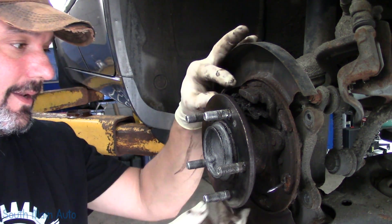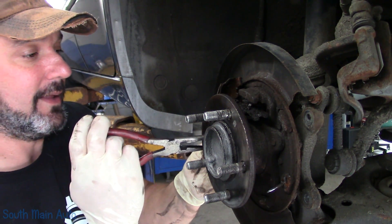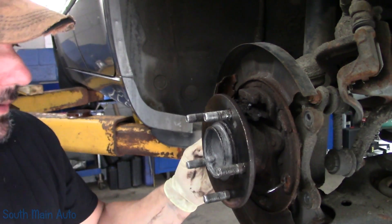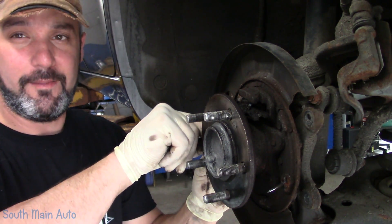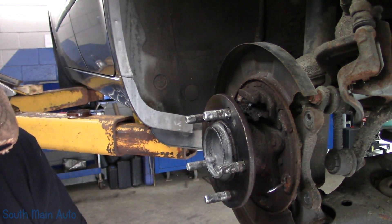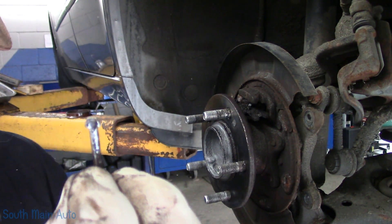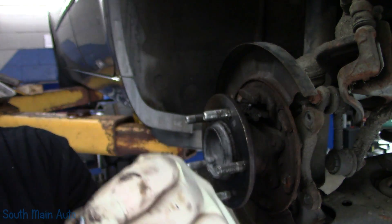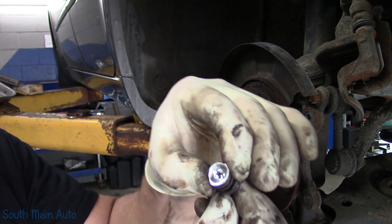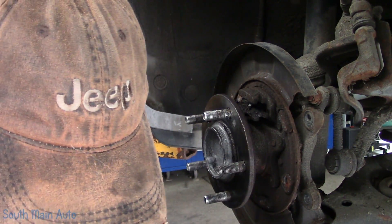So here's the adjuster that goes in the bottom. Same thing on the other side — you've got the cup, pin, and spring. I'll push that in; it's exactly the same as the front one you just did. If it's your first time doing it you're going to drop the spring about 30 or 40 times, but I'll show you how they work. You'll see the head of the nail — it has a little bit of a head on it. When you push them through, push down, they quarter-turn and lock. Pretty simple.